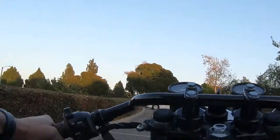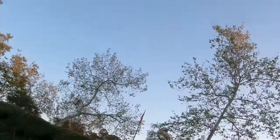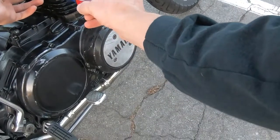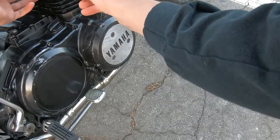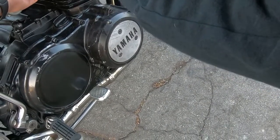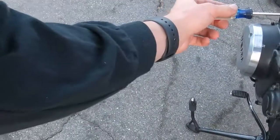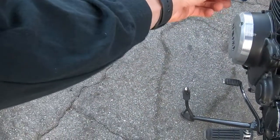So the strategy I use is just to bring along a flathead screwdriver and make a bunch of pull-offs. Adjust all three carb air mixture screws in half turn increments. I adjust them all together in the beginning. I do this around 5 times on, let's just say, a 30 minute ride until I feel like I've got the sweet spot.